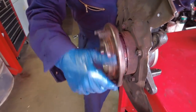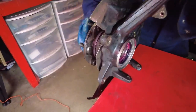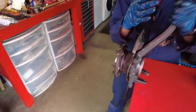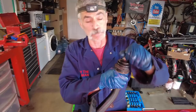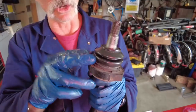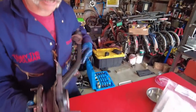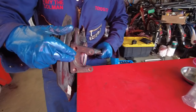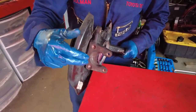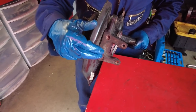One last sanity check: make sure the bearing feels smooth — and it does. Now as part of this job, here are a couple of good things to note. If you detect play in the upper ball joint, go ahead and replace it. If the boot is ripped, Toyota sells a kit — we'll link it in the description. Also, replace the lower ball joints if they've never been replaced, because they have been known to fail. When they fail it could cause you to crash, wreck your rig, and potentially hurt yourself and others.